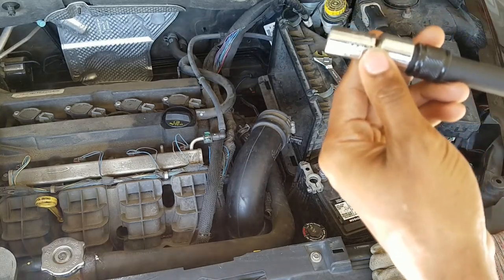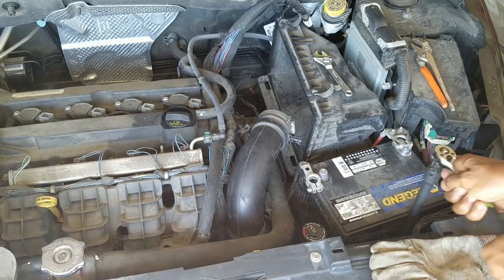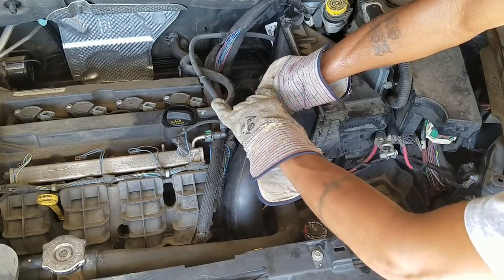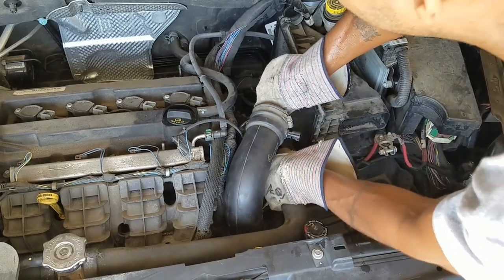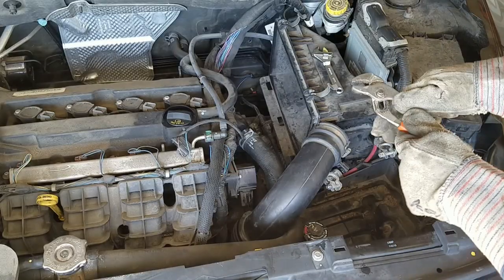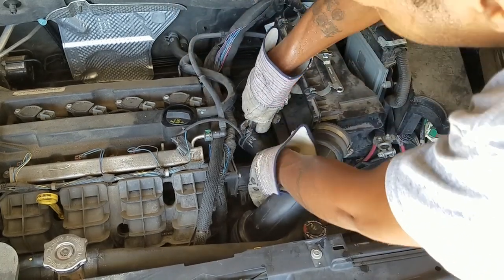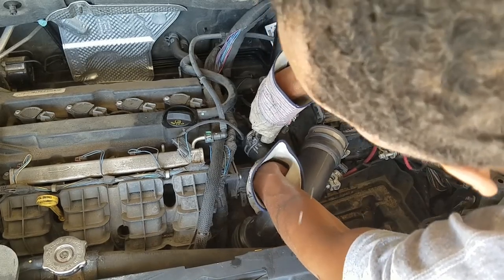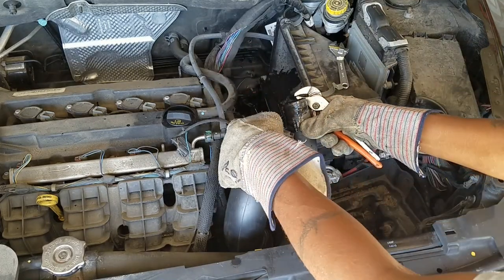This is a 13 millimeter for the battery. In my opinion, getting this radiator hose off is the hardest part. When you pull it off it's going to start leaking antifreeze, so you gotta squeeze the clip and kind of pull on it. I got gloves on because the hose is hot — here it comes. I'm going to rinse some of that off — see the steam still coming from it.